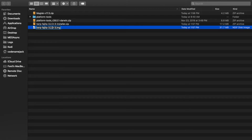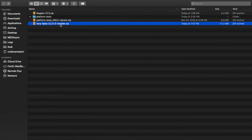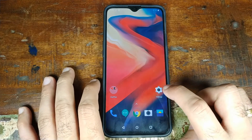Once that is done, rename the TWRP recovery image file to twrp-fajita.img. Then move this file to the platform-tools folder. Inside platform-tools you'll now have ADB, fastboot, and the TWRP recovery image file. The other two files — the TWRP recovery installer zip and the Magisk zip — you need to transfer to your phone and note down where you've stored them on the OnePlus 6T.